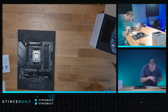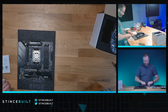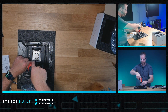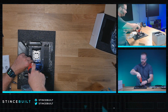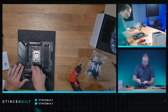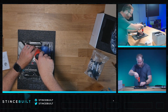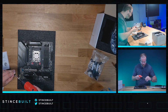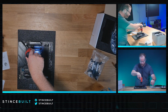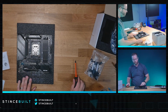You're going to remove the factory bracket and install standoffs, which makes sense. We've got our clips for the fans all here. They take off the factory clip mounting clips and retain the back plate, which is pretty standard in a lot of air coolers on AM4 and AM5. Going one, two, three, four down. These go like so — get them pre-threaded, hand-tighten them, and not over-torque with an electric screwdriver. All torqued down, nice and secure for our brackets.